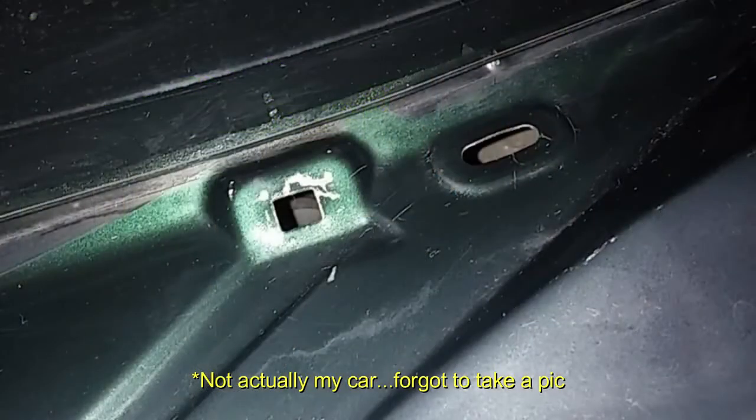With my car, I found water in the passenger side floorboard, which is a really common place for water to be. I looked online first — forums are a great place to start since lots of other people have had similar problems. Right off the bat I found that there's a clip under the cowl that was actually the true problem.